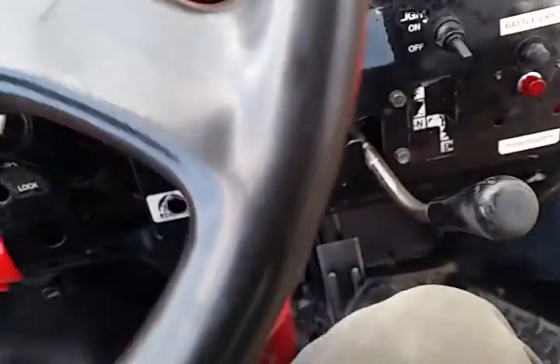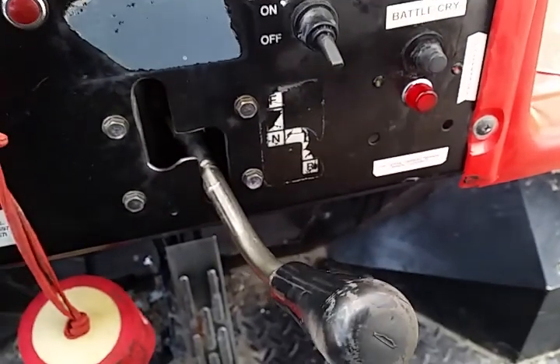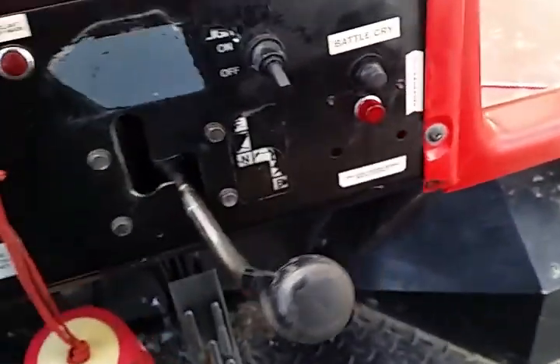So you put a parking brake inhibitor on - if the brake's up and you put it in neutral, it won't start. As soon as you take the brake off, Bob's your uncle. We'll pull it out into the world so we can get good light and do a little photo documentation about what we did. There's a little accessory switch here that'll turn the hazards on if you pull the parking brake - we're not going to cover that in this tutorial, that's too much information.